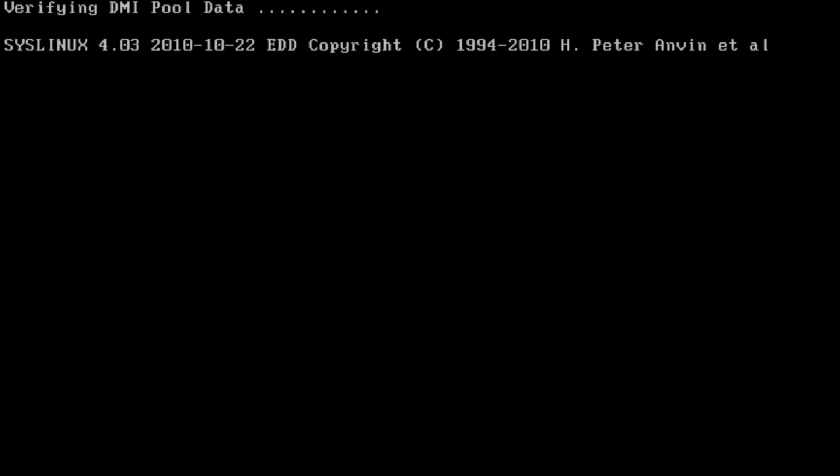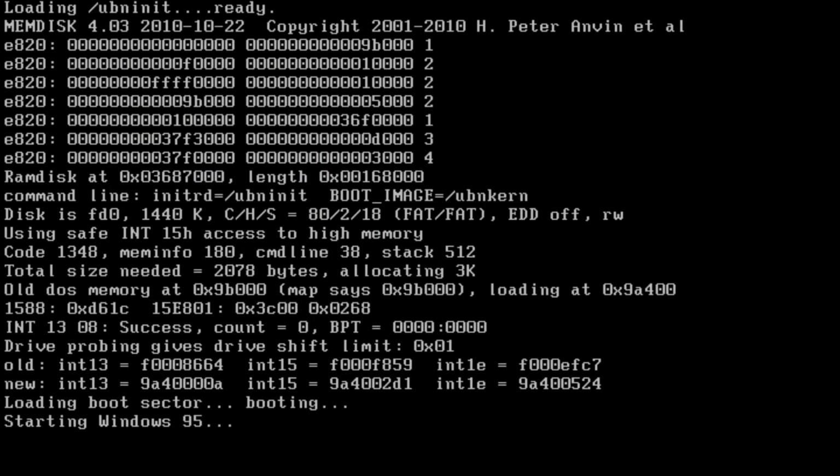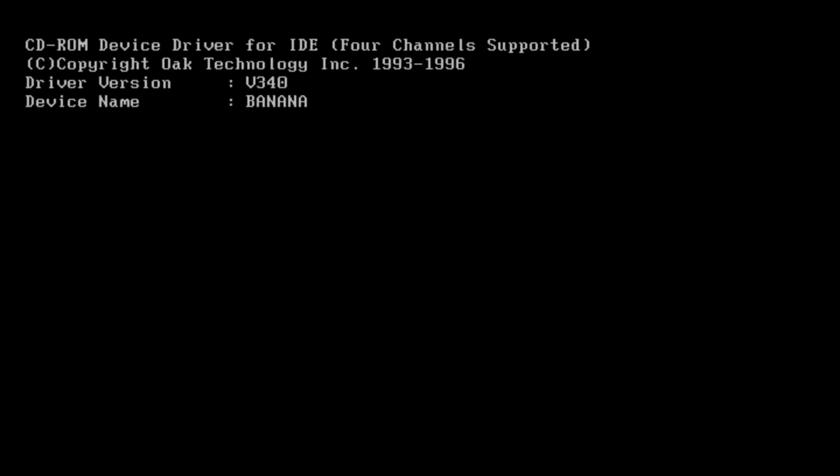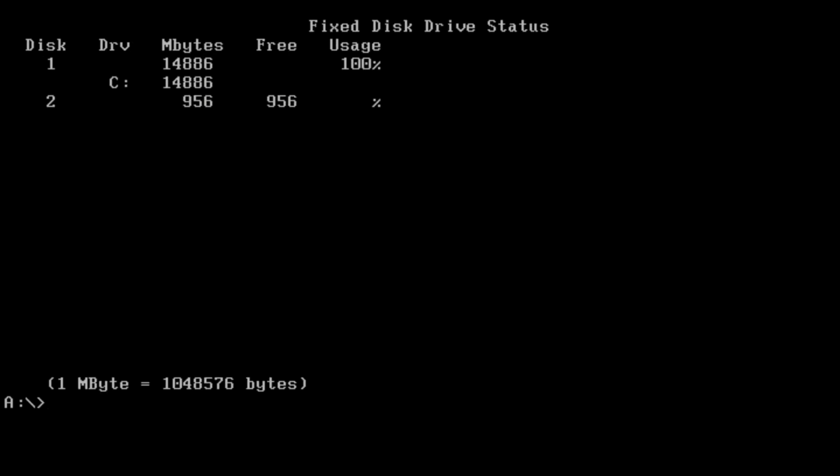We will run fdisk with a command line this time. The command line is going to be a special command. First we want to get the status of the drive, so you'll see me type here in just a second, fdisk /status. That'll show us our two drives and the size of the drives. Now we can create a partition by saying fdisk and 2 for drive 2, /, and the size. If we do that, now we have a partition all set. You don't get any feedback, but it's done. Great. And go ahead and reboot one more time.